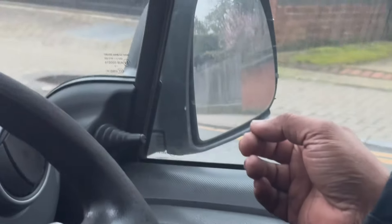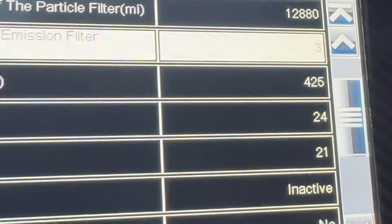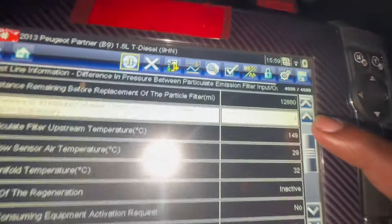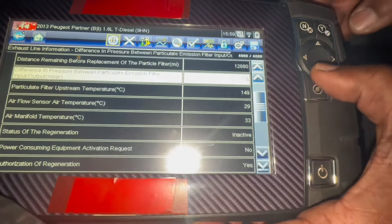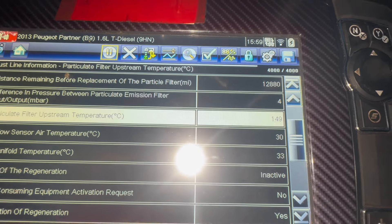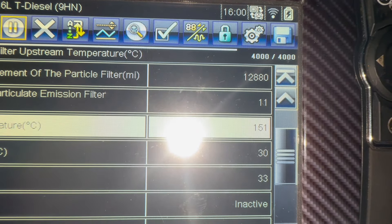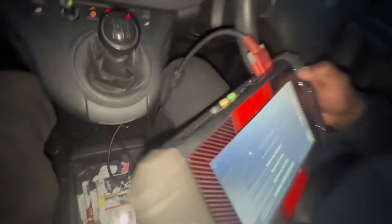I think the regeneration process looks like it's starting. I went on the road test and I saw the regeneration process happen by itself, so I don't want to bother more. You can see when at idle it's four bars. When I do 2000 RPM, have a look - it's 11. That means it's doing the job. Then I'll go back and check if any fault codes are left for the related problem.